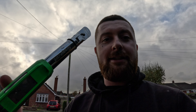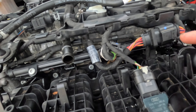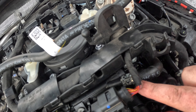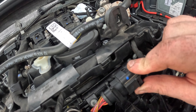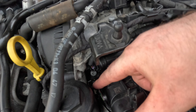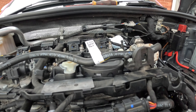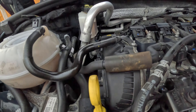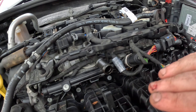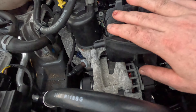After many attempts trying to line up the union and the belt, I decided to remove the inlet to get proper access. To remove the inlet: undo all the silver bolts, pull off the hose clamp pipe at the side, unplug the two connectors here, unplug the plug down below, take the vacuum line off, and once you've pulled it away unplug all four injector plugs on the fuel rail. Then pull the inlet out from this side toward you — it's quite hard to manoeuvre out from by here.